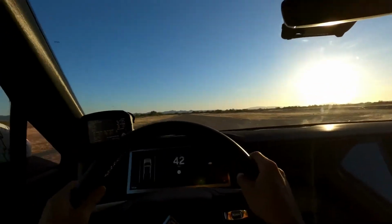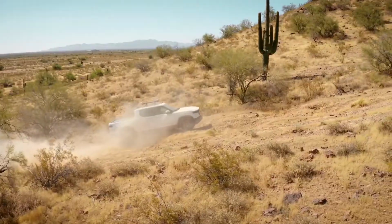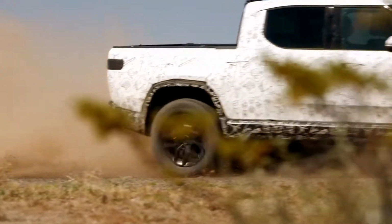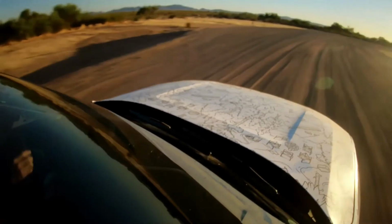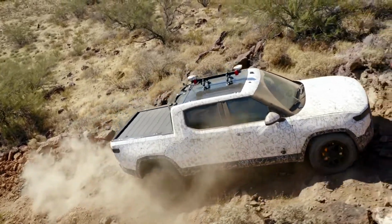And then we're adding layers of software, slowly implementing new features. So the vehicle will start to recognize the terrain it's on or the mode it's in, and those will be happening underneath the skin. It'll be doing it by itself, essentially. And that's when things get more and more interesting for us in the software world, where since we have individual drives on all wheels, you will be able to estimate friction across sand dune or ice or snow. This vehicle can do quite a lot of things.